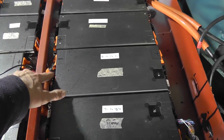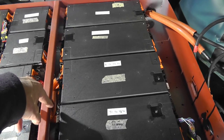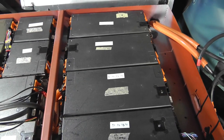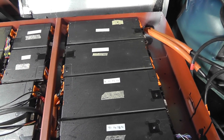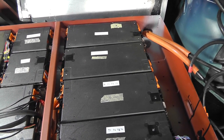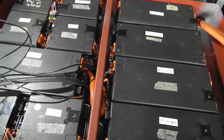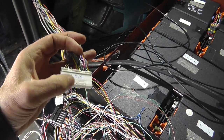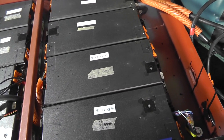The ones that are going down into the cubbyhole battery box, they're fine. It's the ones going to the fuel tank battery box which are wrong. So that's 16 of those leads I will have to cut and remake and re-patch. Basically what would have happened is they would have ended up in the wrong point in this connector. So I need to remake them.